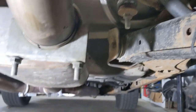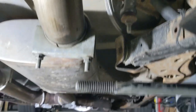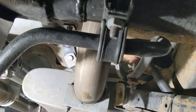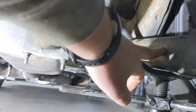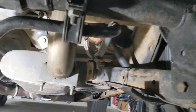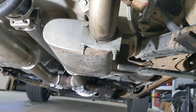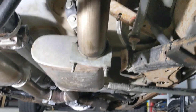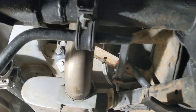I'm probably going to have to do a couple tweaks because the CPP bar mounts from that lower control arm bolt. You can read the directions — they're helpful, they tell you where to put things. They do sell drag-focused bars, but this car is a street car. I want to run 10s and do autocross. I don't really like that much stiffness from the heavy-duty ones that go on the lower control arms. The CPP bar is adjustable. And since I have 3-inch mufflers, there's a little less room underneath, plus the fuel system. I'll skip most of the install part because it just bolts in — if you buy it, you can read the instructions.